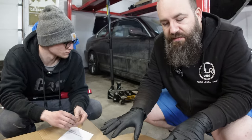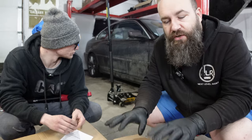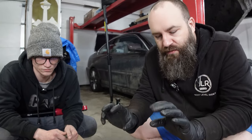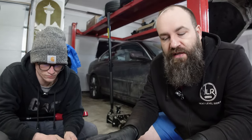One important thing to keep in mind: springs will settle, so you should drive them for a few hundred miles or kilometers. There's a good chance you'll need to readjust the ride height. I recommend not going straight to an alignment — drive on them for about a week, fine-tune the ride height to where you want it, then get an alignment. They're going to drive completely night and day from install to a few days later.